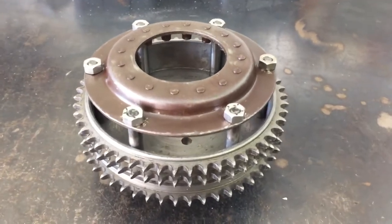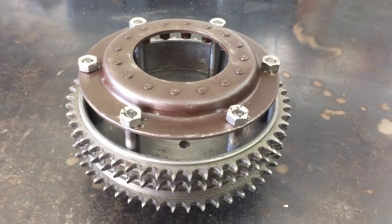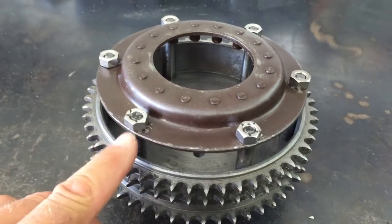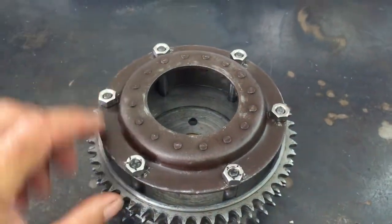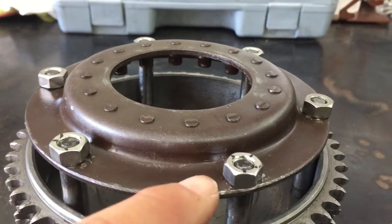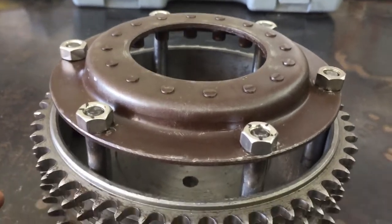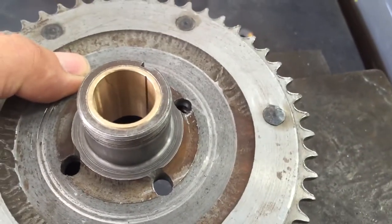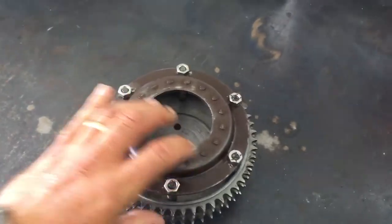Check the clutch sprocket studs are tight. These are riveted into the clutch sprocket themselves, and they do come loose once in a while. What we do is put the clutch pressure plate on top — it'll hold all these in their proper location — and use regular nuts, not jam nuts. When we rivet it on here, the nut itself is going to be making contact with the surface and not the stud, so it's not going to burr over the end of the threads. Put it on a good solid surface like this, and with a ball-peen hammer, tap on the end of the studs. You'll be able to reclaim your clutch sprocket that way.